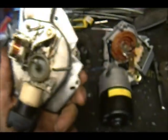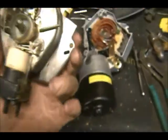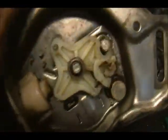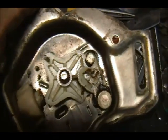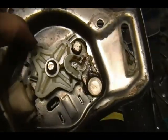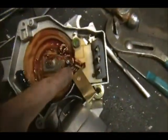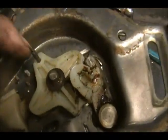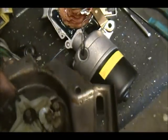Okay, I'm back. I'm just adding a little addendum here. They give you an actual cam alignment tool. You have an access hole there, and on the back side of the gear, you have an alignment hole. I think they want you to align these two points. So when you put it on, you're riding on the stud that's provided, which in turn sits in that little channel, that little pocket. If you don't take this step, I think you're going to mess stuff up.